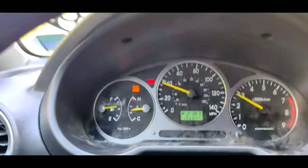I did also realize the other day that I'm backfiring a lot more than I normally should be. So I definitely am going to get a new fuel pressure regulator. And also, I don't know if you guys noticed, but it's kind of looking like a Christmas tree over here. That cell is for P0457, which is just an evap leak, so I think it's actually my charcoal canister back there, because whenever I pump gas, it's weird after doing it upside down. So yeah, a couple things are in the works.